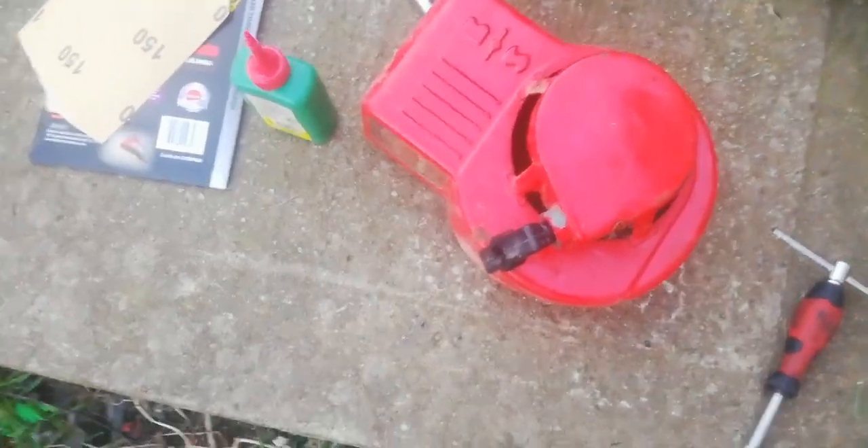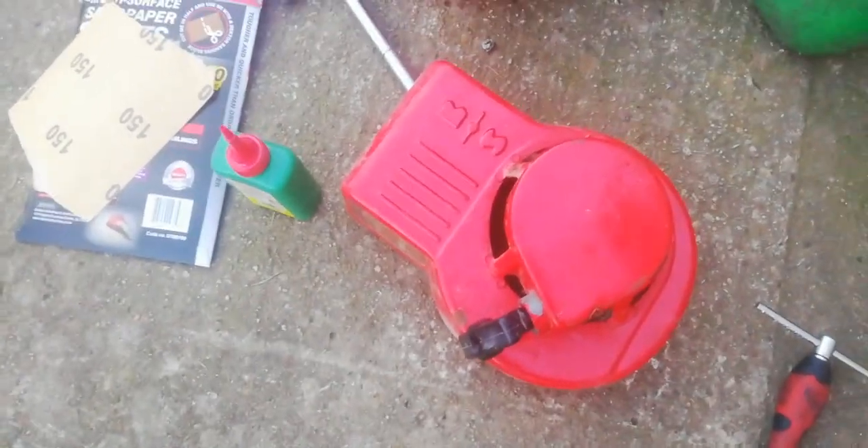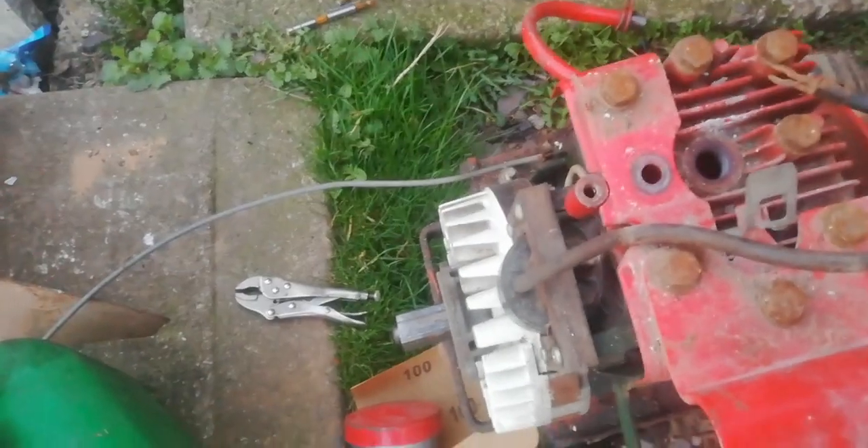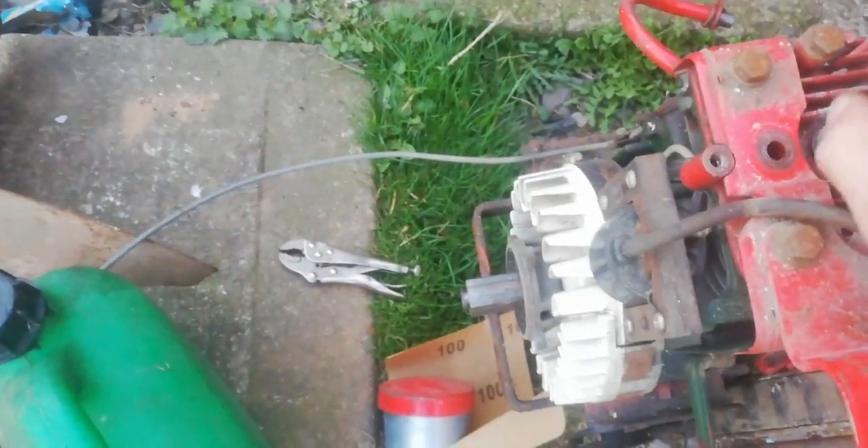I'm just going to rub this flywheel down and show you the result. Put the casing back on. I'm going to oil down the pull-start cable because it's dry — really dry and solid, hard to pull out, restricting quite a lot. I'll clean the flywheel off, sort the pull-start out, and may take the coil off. I'll clean the contact up there as well. The spark plug looks good. You can always determine how a thing was run from the colour of the bottom of the spark plug — you're looking for a browny colour. If it's whitish or really wet and black, it's running wrong. Nice and brown is what you're looking for.